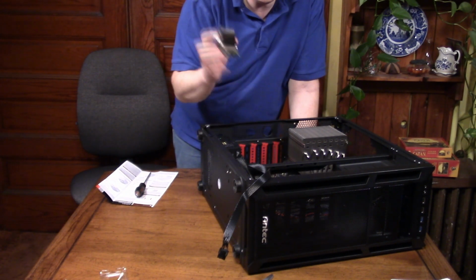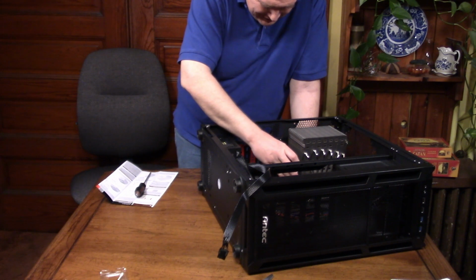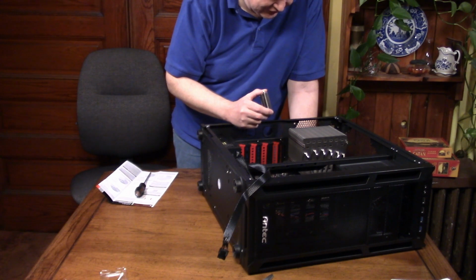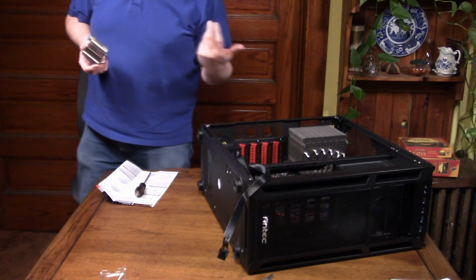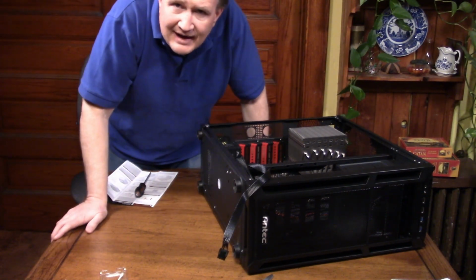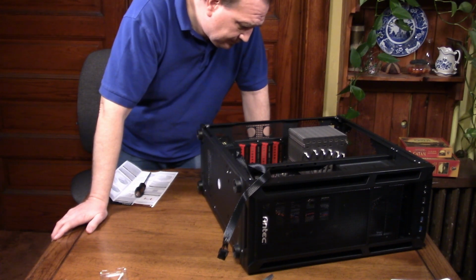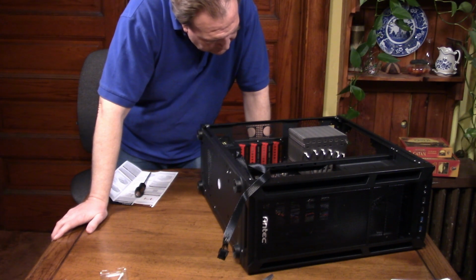But it was silly anyway. It was more about the looks, I think. But I will find some other thing. I wasn't real happy with the heatsink that came with it. It's got that built-in heatsink. I think I showed you in the last video, but when I took it off, you could tell it wasn't making contact with all the chips on the SSD, which means the chips that weren't getting contact weren't getting any heatsink contact, and then the airflow was blocked by the heatsink. So I don't think I'm going to run the factory heatsink on there, but yeah, there it is.